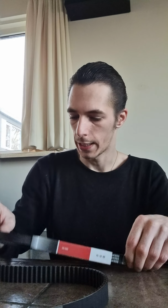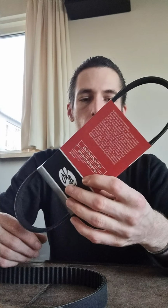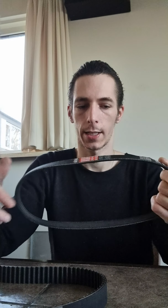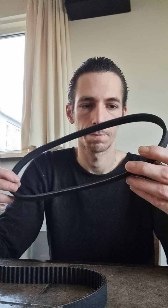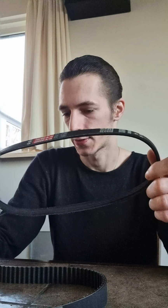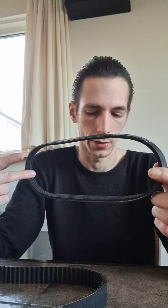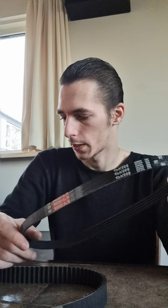Now, I have tensioners on it, so that's good. And one of the other things is the power steering pump belt. So I'm gonna also unpack this one like that. So also this one is 668 instead of 665. So the 668 and 665 is for the size. Now this one is only a 3 millimeter difference. But those 3 millimeters, well, I'm not really worried about it.